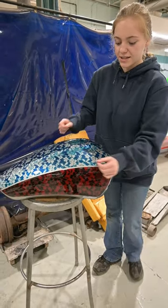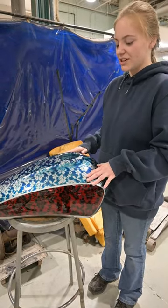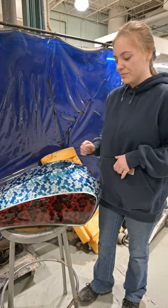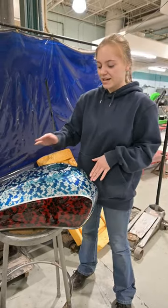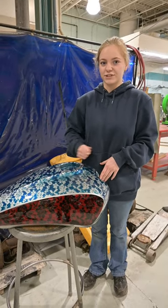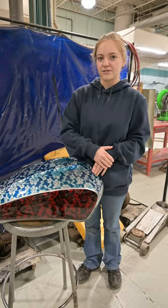I had to re-tape this to keep that silver in, and then we put the lace over this — which is the hardest part to try and keep it straight because it tapers off so much in the back. Then we sprayed our blue. Once we got a few coats I took the lace off, then we had to clear it all over again, and afterwards we wet sanded to get all the fuzz out from the lace.